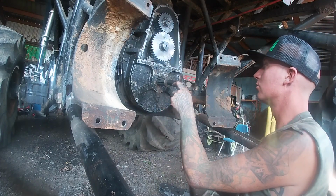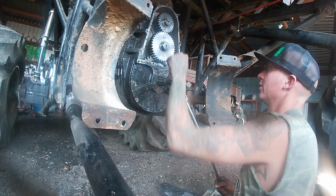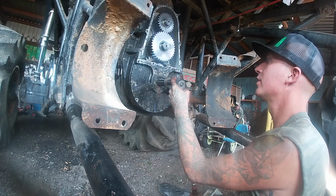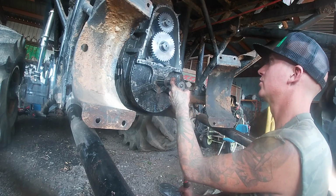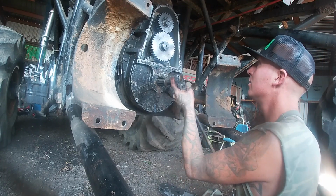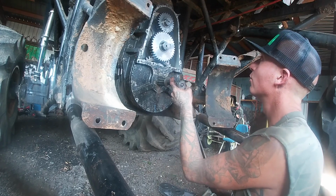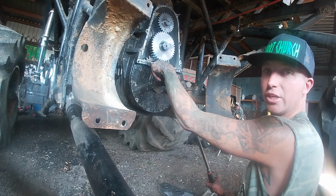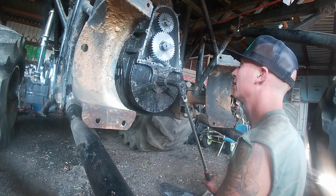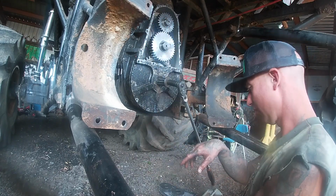So there we go, with the little gear on top. Let's watch the line on the bottom and the marking on the top. There we go, top's going around. There's 1. Here comes 2. 3. 4 to 1. You can see that the bottom gear is turned 1 revolution. My top gear is turned 4. I guess I could have done that quickly in my head, figuring the small gear should have gone on top. Oh well.